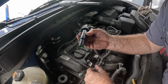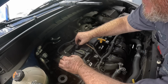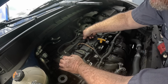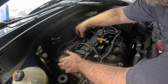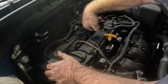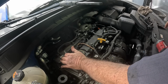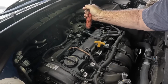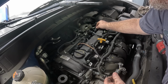New coils come with dielectric grease, just like the AutoZone ones. I'm telling you, it's got to be the same manufacturer. It's the same green dielectric grease and everything. Connector is a tight squeeze. You gotta be careful too when you're pushing a connector together and it's fighting you. Sometimes one of those pins will be bent, and then you'll really crush it. And I don't mean crush it like in a good way. Look away if you're easily traumatized. The injector pump will not be removed for spark plugs. That's just how it is.